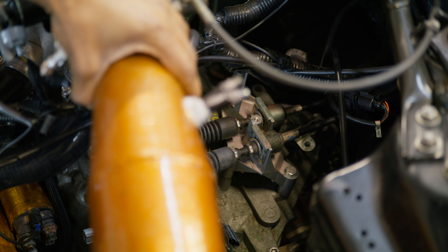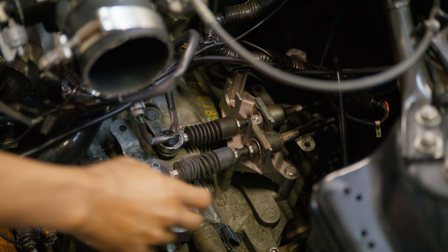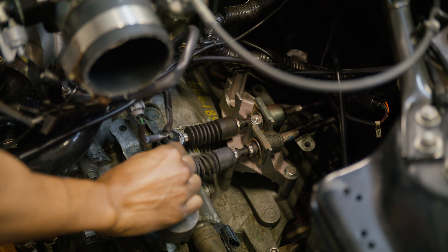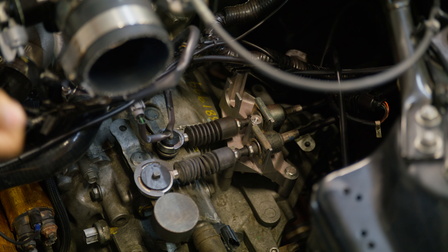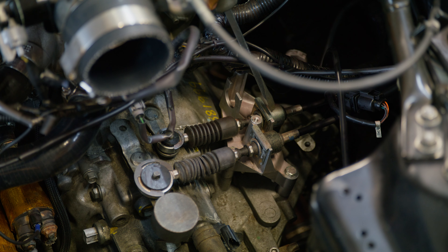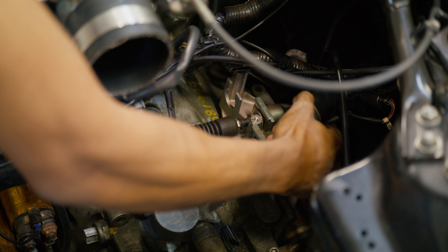The first thing I did was remove my intake from out of the way so I have easy access to the shifter cable itself. I'm going to go ahead and remove the pins that hold the cables to the transmission and set those aside. Now there are two clips here that actually lock the shifter cables to the billet shifter that we're going to be providing, so we're going to go ahead and get those clips off first.